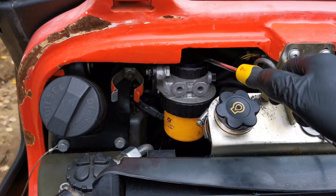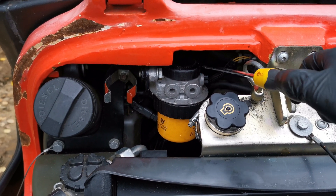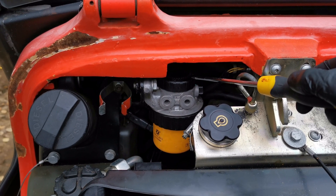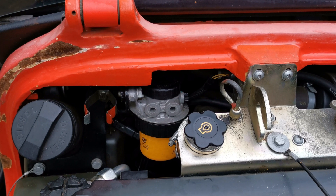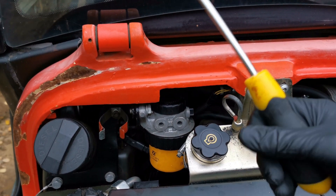On some models you're going to have a little handle, a little pump right here. You loosen this nut and then you bleed the filter by yourself without turning the ignition on, and then of course when you crank the engine, the engine will bleed the whole system. That's it. If it was helpful, subscribe and like this video, and see you in the next one.